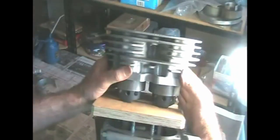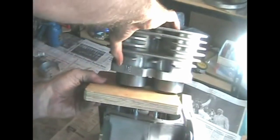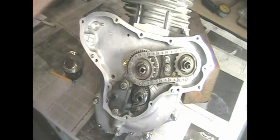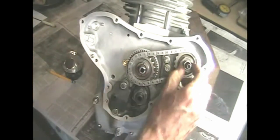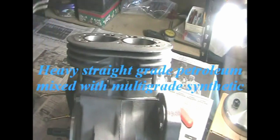The ring clamps are removed. We're going to bring the cylinders down a little further, then remove the piece of wood. Now bring the cylinders down over the bolts, but not all the way or you won't be able to get them started. Install the bolts and tighten everything down — don't forget to remove the rubber tubing from the tappets. Install the timing gear before you bolt on the head; that way the valves won't bang into the pistons. When you adjust the chain tension, spin the motor all the way around checking for tight spots. If you're going to time the cam, you might as well wait before you tighten up the nut because you're going to have to remove and change the woodruff key. Squirt some oil down into the lifters. Ready to put on the head.